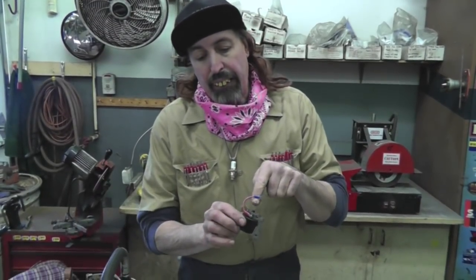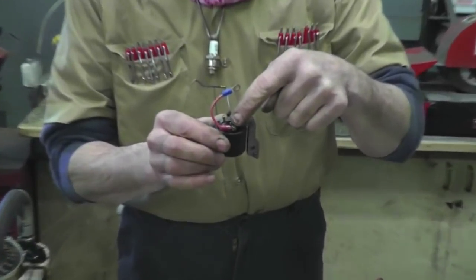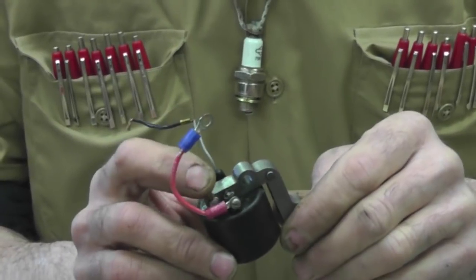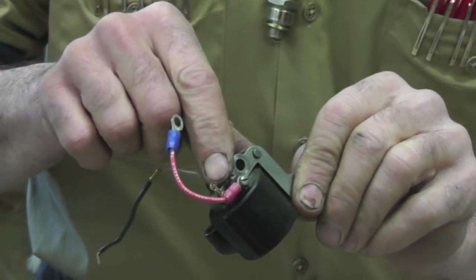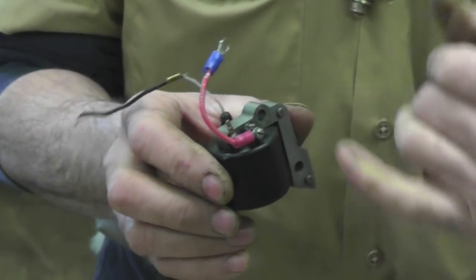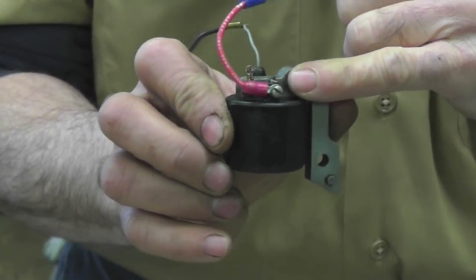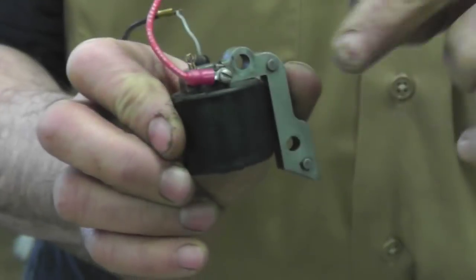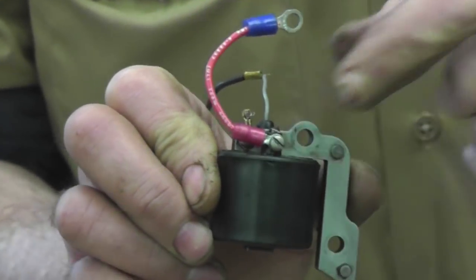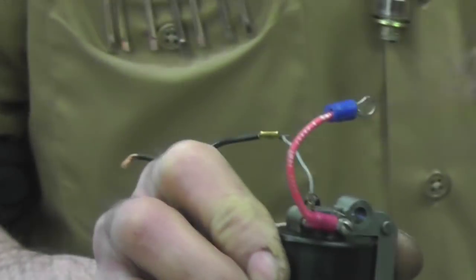I tried to repair that wire that was going from here to here. I tried crimping it, and that didn't seem to work. I think the wire was broke more down here where it goes in. So to make the repair, I drilled a 5/64 hole this way. And then that's a screw from a throttle plate on a carburetor. And then I just made up this jumper wire.